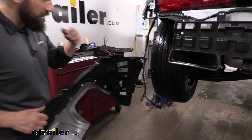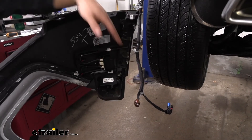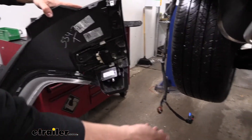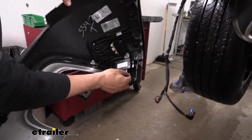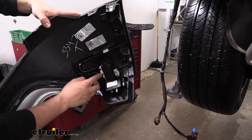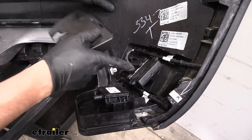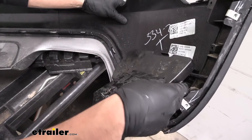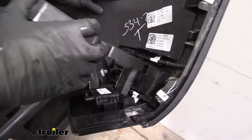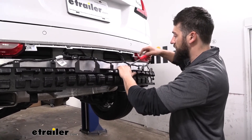Over on the driver side, the instructions don't make any mention of this, but our vehicle appears to be equipped with some extra sensors. To actually get this off and separate the wiring harnesses, undo some more of those clips. There are two plugs from two modules tucked way back on the lower bumper valence — there will be some red security tabs to pull out, then depress the two clips. Also note: there is a little cover panel covering those plugs, held by a clip and one T15 Torx screw, which you'll need to remove to access those connections.